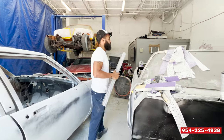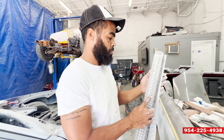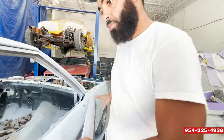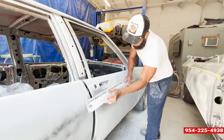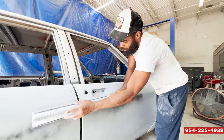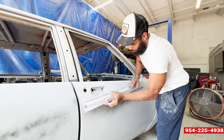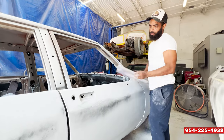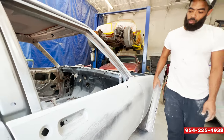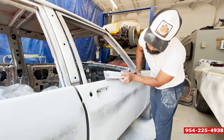It's gonna be a whole movie, this car. I got these long blocks — stubs brought me — you motherfuckers good too. Look how much ground they cover — the whole door — and you can see where your low spot and your high spot real easy. See that low spot? That's how you see it. These blocks make it pretty easy for me because they cover a lot of ground, and that's important when you block.